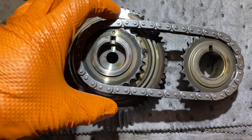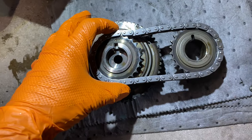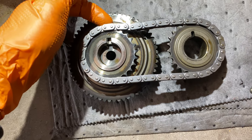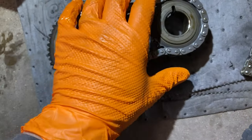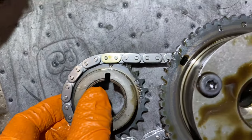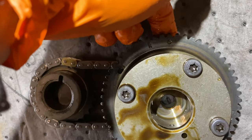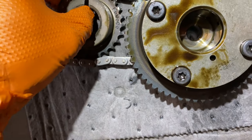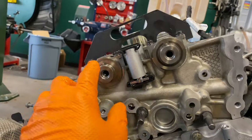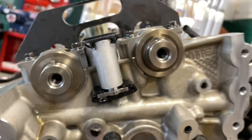Here's how you're going to set this up. It really doesn't matter how you put the chain, whether it's this way or that way. You line up — it'll have a gold link on the front right here and also on the timing mark. See that little index line? The gold link is directly on the mark on the back side of this gear as well as on here. When you go to set them on the cams they will line up perfectly with the detents. I have the new tensioner just sitting there resting in place — see the little pin there? We're going to pull that once we get it all set. I'll show you how to mount it.